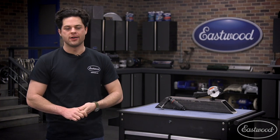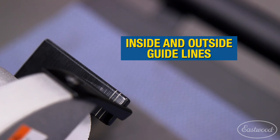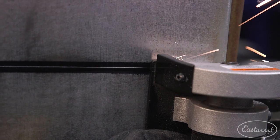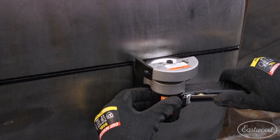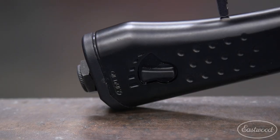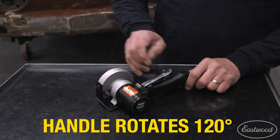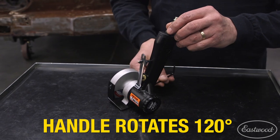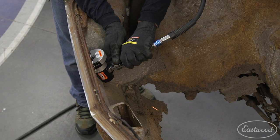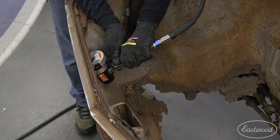Starting off with a quick breakdown of the saw. The biggest feature I like: laser etched guides inside and outside of the blade on the foot. They're really easy to read, especially if you use some marking fluid or sharpie to scribe some lines — it makes cutting straight as an arrow very easily. The handle has a speed adjustment right on the side, and it's a paddle style handle that also rotates around the blade, making it really easy and comfortable to work into tight spots — very handy for under hood areas, trunks, wheel wells, and foot well areas.